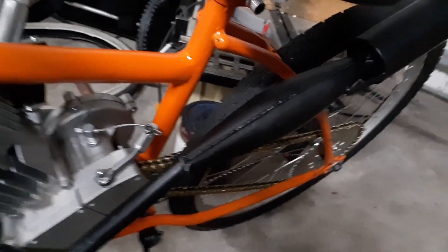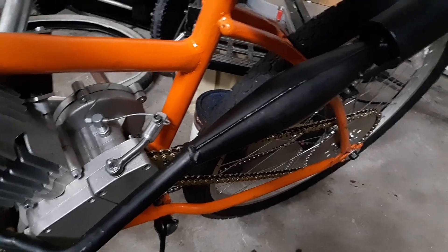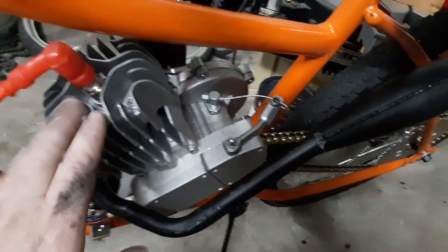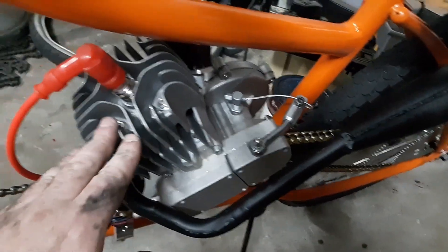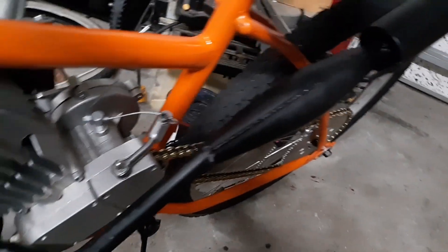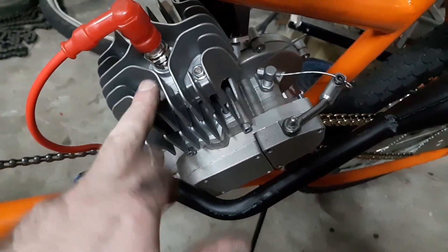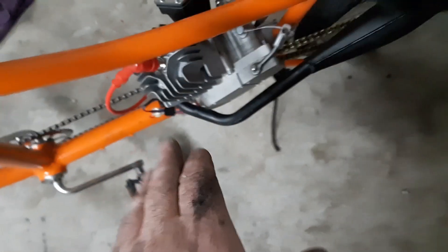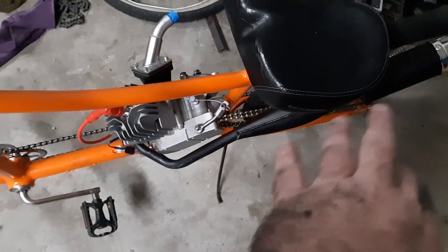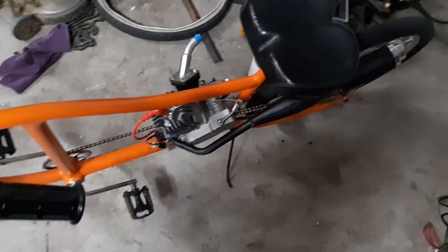That's one of those little pit bike exhausts. I got it on there. Funny enough, that little tiny chamber — you gotta remember, this is going to be a low RPM build, not a high RPM build. So we don't need a gigantic fat chamber on this thing. This is like 4,000 RPM, and it's made to put out some super amounts of torque. So that's going to be the goal. I'll have to get a clip to mount that up at some point, but there's the exhaust.